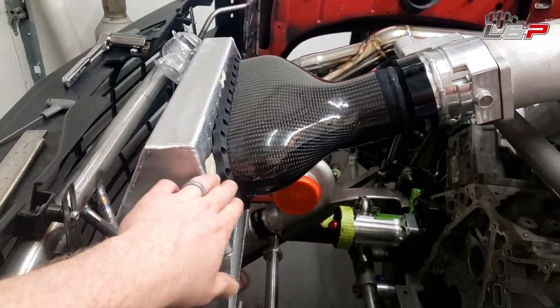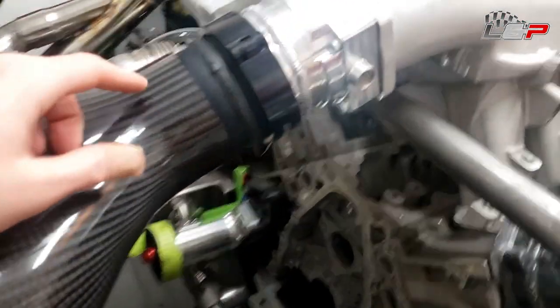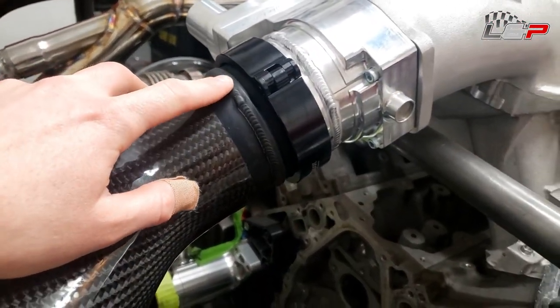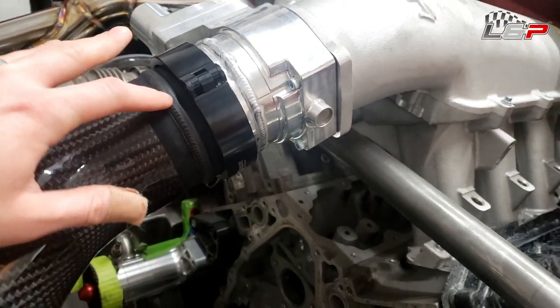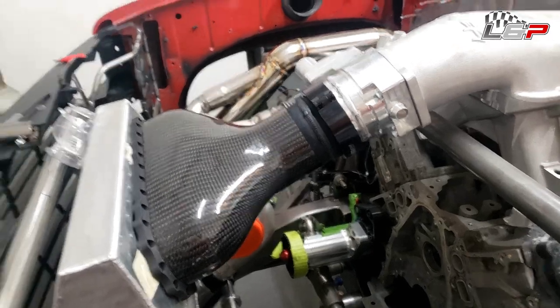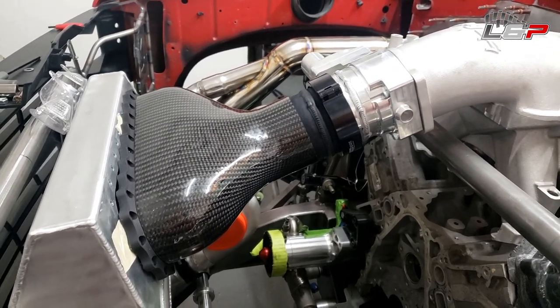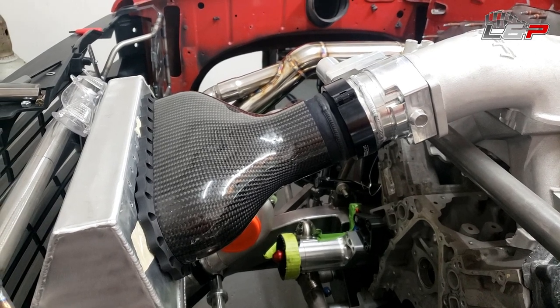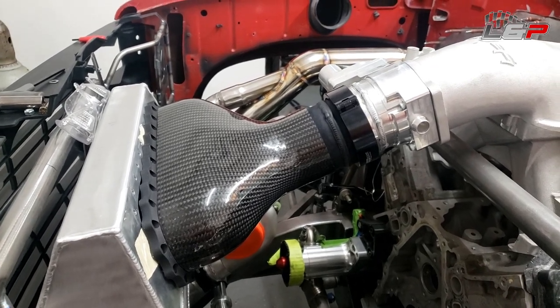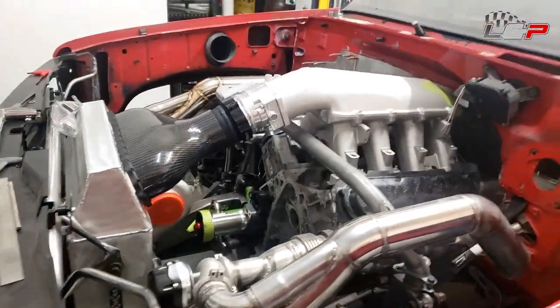The bottom came out great. Really happy with that. What I didn't realize at the time is the alloy that I used to weld the top doesn't take anodizing very well. It anodizes, but it doesn't color match to the other material. So what I'm going to need to do is Cerakote it all and then bond everything, and it's going to look great. But I am really happy with how that is looking.